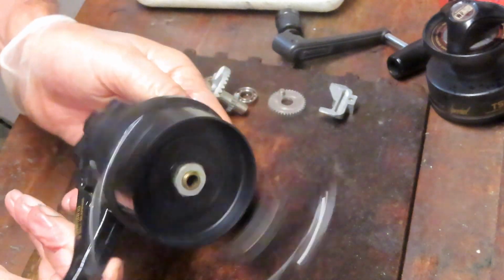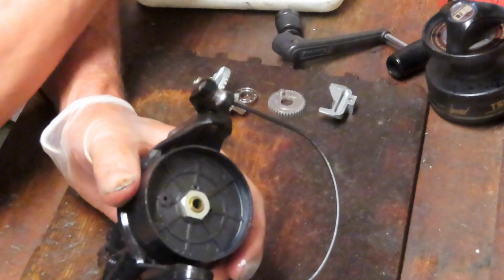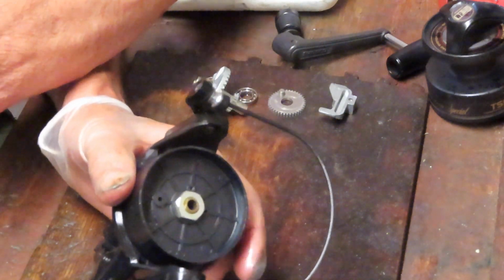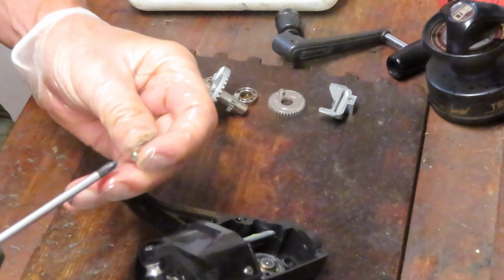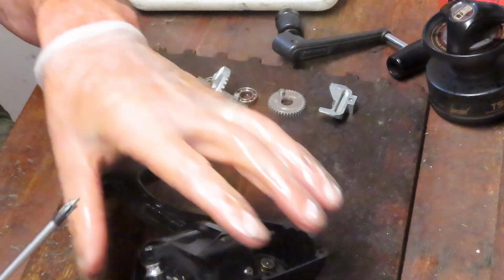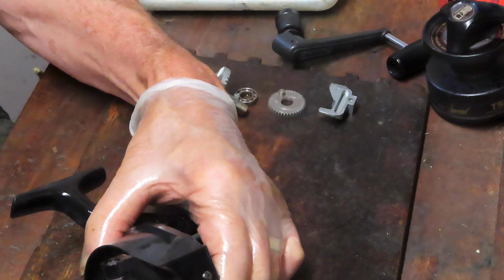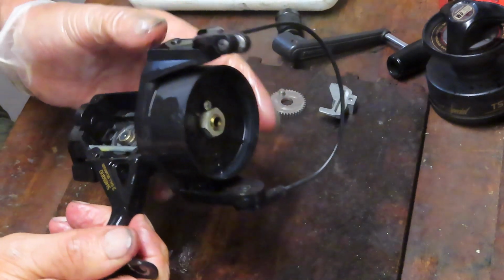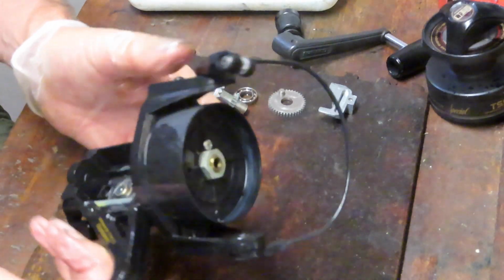Before I go any further, I'm just going to spin it, make sure that we have a nice spin to it. There's no sense putting some other pieces in there only to find out that you got to redo it or something got jammed while you were doing that. There is one tie down screw now that goes into that hole, and that'll keep that rotor nut from spinning. Alright, there we go. And if you like, you can test your rotor trip lever at this point as well.